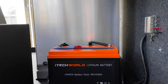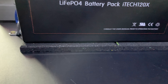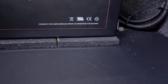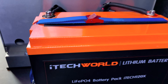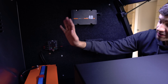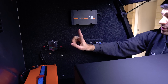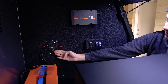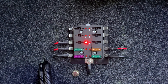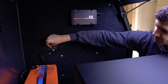The battery is the iTech World 120X 120 amp-hour lithium battery. To mount it, I've put it on thick anti-vibration matting to keep it safe on corrugated roads, then strapped it down to the canopy floor with strong tie-down points — one at the front, one at the back, and a ratchet strap over the top. Power is then distributed through the canopy through the fuse box mounted on the headboard. It's a really cool piece of gear with 10 different outlets, and when a fuse blows, signal lights show you exactly which fuse has gone — takes the guesswork out of solving problems out on the tracks.